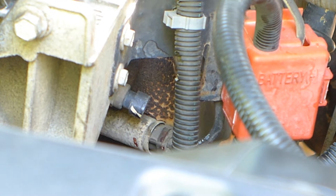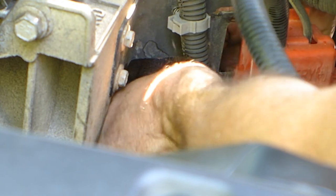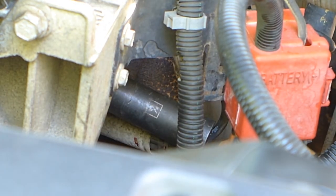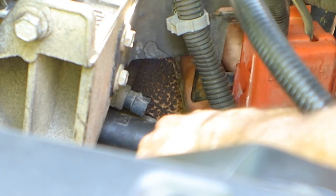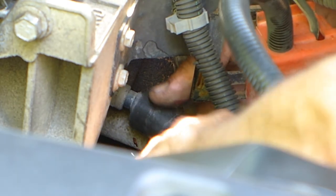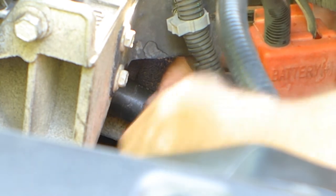If you have a 2005 Sierra B-VIN, it's definitely the right part number. You'll need a three-quarter inch deep well socket. A lot of times when there's not a lot of room I'll put the socket on first and then put the wrench on, but in this case that didn't work out, so I ended up putting the socket and wrench together like a normal person, which works just fine.